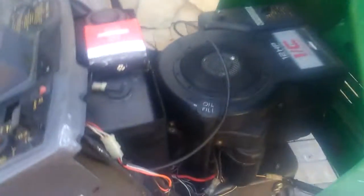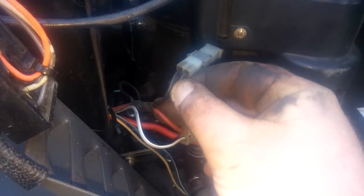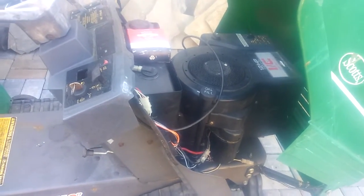I also still have the wiring. It's one of these ones — I believe it's this one right here. I just ran it up into here and taped it up. It's a single wire right here and it comes out to two right here, because I had this plug — one's a constant feed and one's a kill. And the engine I'm thinking about putting in here also has the idiot light for the oil pressure, which I do believe I have an extra spot up here to put an idiot light in.